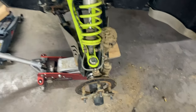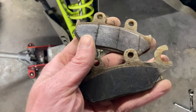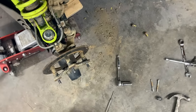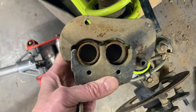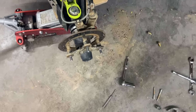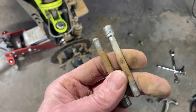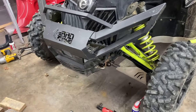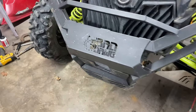Now I'm in the process of doing the same thing to the front brake calipers, and these are much more worn — very thin, so they definitely need to be changed. It's pretty much the same process. These are double piston calipers, so twice as effective as the rears. The pins are still in there; they come in from a different direction but they need to be cleaned up. Then we'll put the new ones in and do the same thing. All the brakes are now switched over to new pads. The front ones definitely needed it bad.